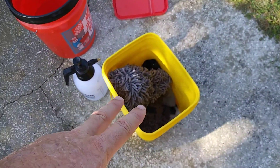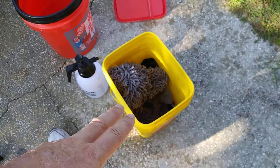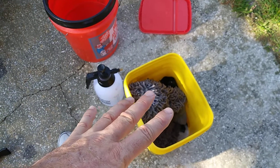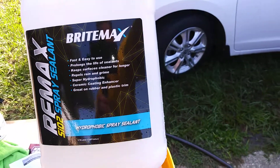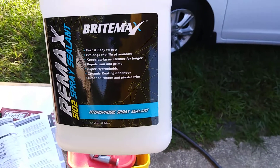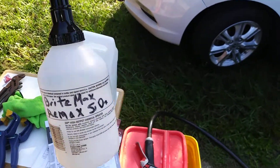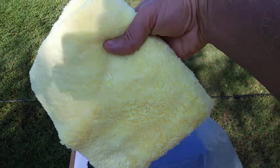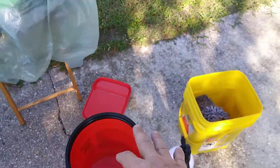I just did a very light contact wash. I've got a number of wash mitts in my bucket — I was going to use the airless sprayer with all distilled water today, but unfortunately that's not happening. I put a gallon and a half of distilled water in with a pH-neutral basic car soap. I am going to put my Remax Brightmax spray sealant — actually it's Brightmax by Remax, from England — I buy this by the gallon, it's an amazing product. I will be doing a dry application, spraying it on and buffing it off with my Jacks towels from Luxury Microfiber.